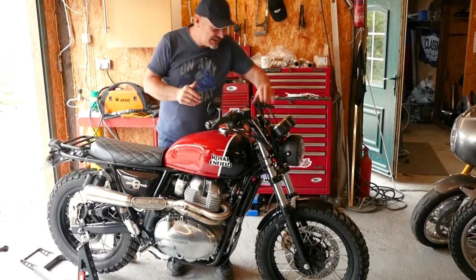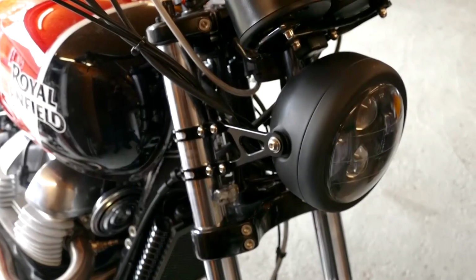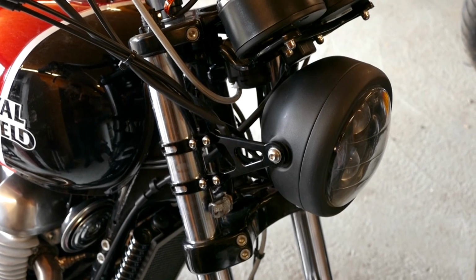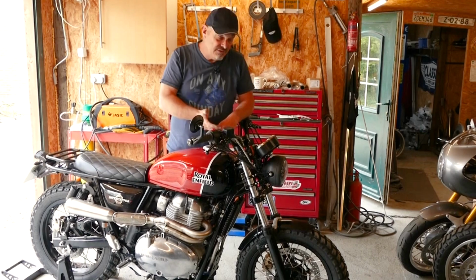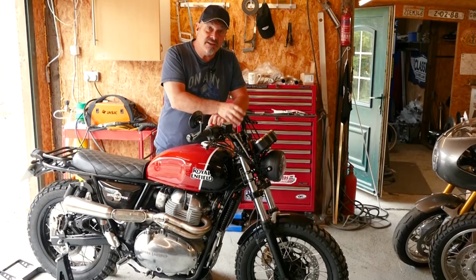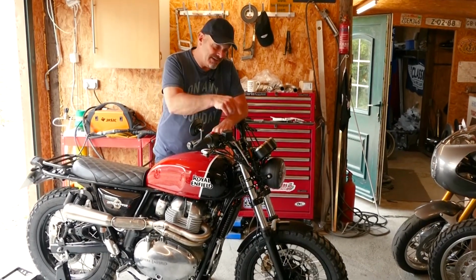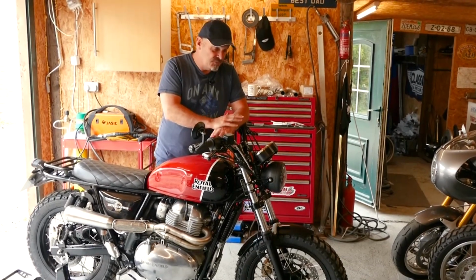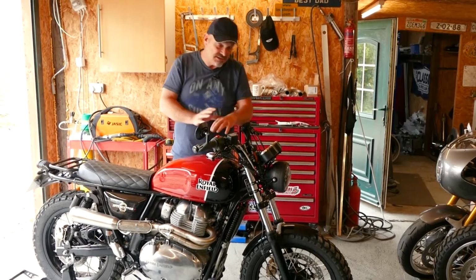We've put a small headlight on the bike, which was surprisingly easy actually. With the headlight brackets we've got, all we did was put the headlight brackets on the inside instead of the outside, and it fit the small LED headlight perfectly. And surprisingly, which you can't do on Triumphs, we managed to get all the wiring in the headlight. Even the resistors for the LED indicators went in there, so that was a nice bonus. We didn't have to mess on with the wiring at all. No chopping, anything, all total standard harness in there. So that was a nice, neat thing.